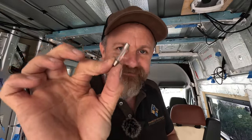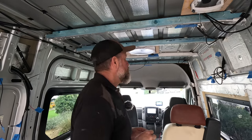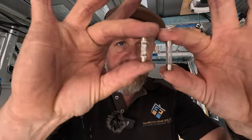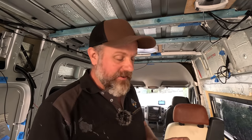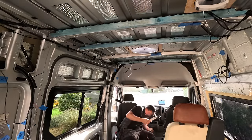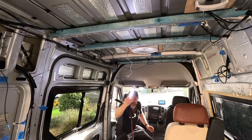I've just pulled apart the plug on the 12-volt adapter - there's a little fuse in it and it's gone. So hopefully it's not the fan, but now I need to know what other options I've got for wiring this up in the van. I could bypass the fuse - I haven't got the right fuse to fit in there but I've got a standard household 5-amp fuse. There was a spring holding the thing in. I've had to stretch the spring inside because the fuse was shorter. The light's still plugged in - let's see if that does anything. The light works! That means the cable works. Now does the fan work?